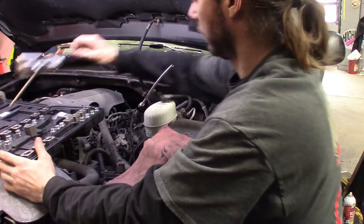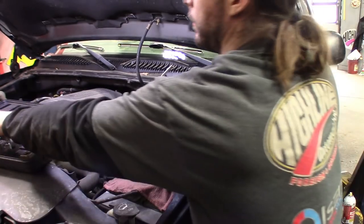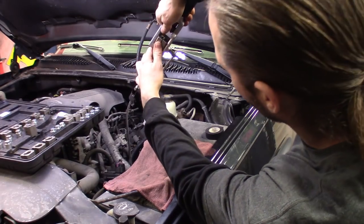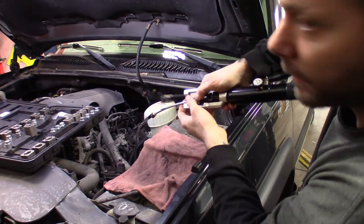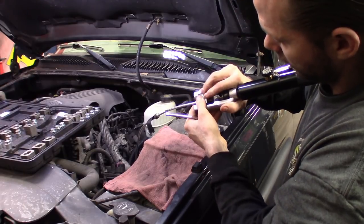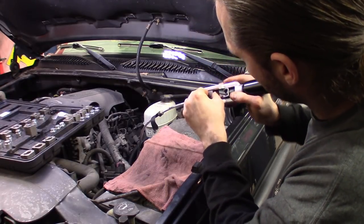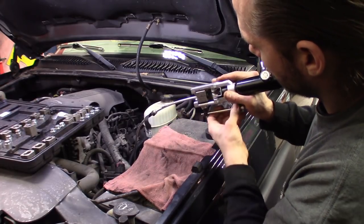So I'll set up the tool. Unscrew it — it's a quarter-inch line — and slide it in there. You want to get it started flush with the block. You don't want too much sticking out or the flare won't end up being perfect. Keep it flush with the block and tighten it off.